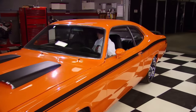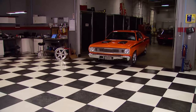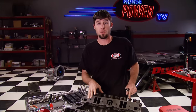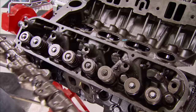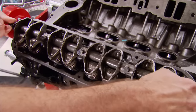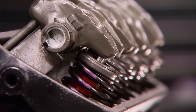We're back, but the Mopar's gone — the Duster's off to a car show to chase down another trophy. We're going to finish off our budget 360 build. Earlier Joe showed you how the oiling system works. The next step is to drop in the solid push rods. Just like in the old days, we're using stamped steel rockers loaded onto the original one-piece shaft. The rocker ratio is 1.5 to 1, so the valve tip moves farther than the push rod tip on the arm.